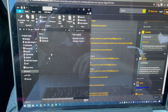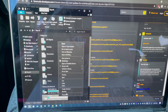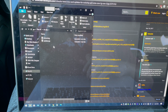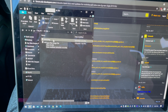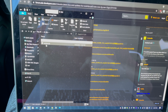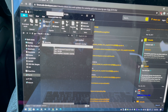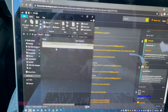What you want to do is format your flash drive to FAT32 — I'll show you right now that this is formatted FAT32 and it's just a small 16 gig drive. Open up the flash drive, make sure there's nothing in the root directory, then place the MCU update — which is going to be a .image file — right inside the root directory. Then open up the zip file you just downloaded, and there's going to be an update.zip folder in there. Take that folder and paste it into this directory. You just want to have these two files in here, and that's all. Now we're going to jump back over to the truck.